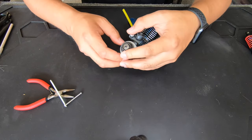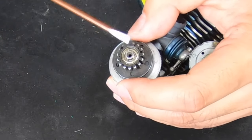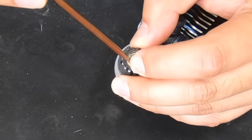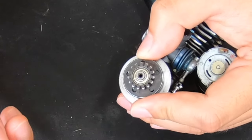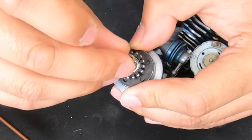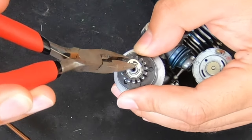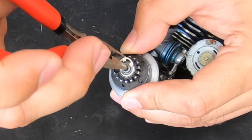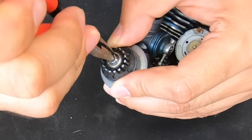I'll do it on a motor since that's the most common one — you typically want to change your clutch bell bearing or something like that. Again, just put the corner of the needle nose in there and rotate — the E clip slash C clip comes right off. To put it back on, put it in the grooves and you can put the needle nose in the middle and just shove it on. Make sure it's in the grooves and bam, that's it.